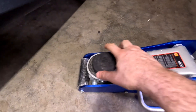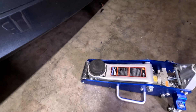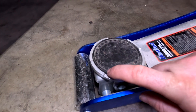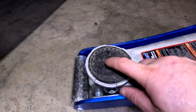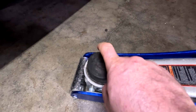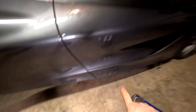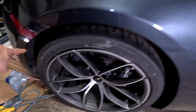There's a little green bubble right there — that is where we want to lift it up. I have a hockey puck on here; there's nothing special about it, it is just a hockey puck meant for hockey. The reason we use that is because this flat spot has little teeth and we don't want to get into the tub. Sometimes the rubber pads work fine, but I want to make sure they stay away. You can also take a rag, fold it over several times, put that on there — that will prevent it as well. We're going to get the lift point in place and jack it up just enough to get the rear wheel off, because the ECU is back here.